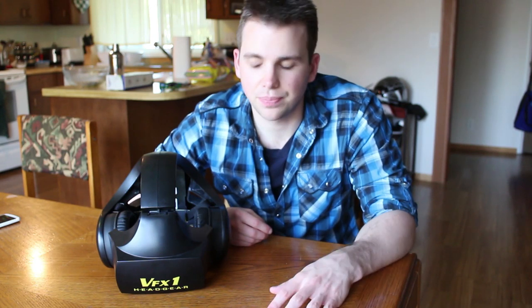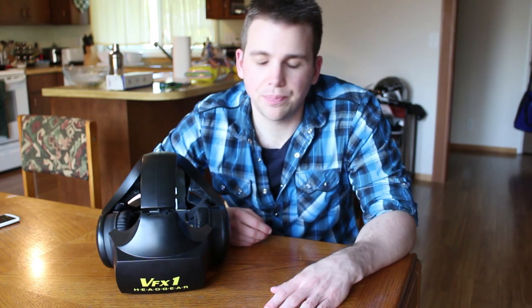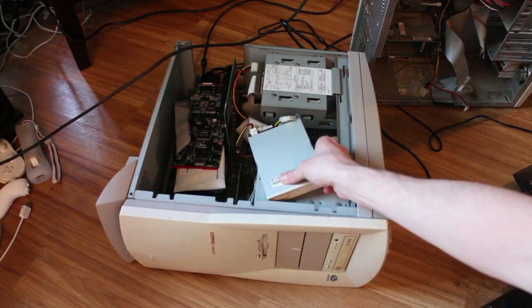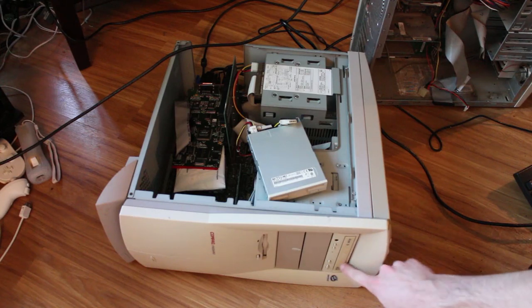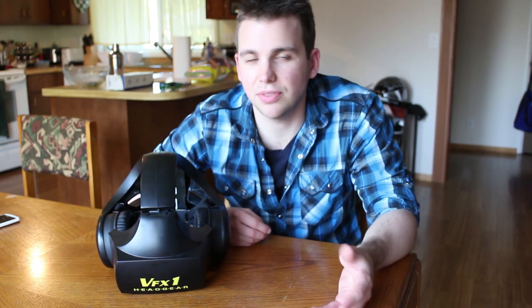Once we had the right computer, we had to get the operating system installed. That meant installing either MS-DOS or Windows 3.1, or maybe Windows 95. We opted for MS-DOS 6.22 because it was easier to get and easier to install. Although it actually wasn't that easy for us to get it installed. We had a computer that could only boot to floppy disk or hard drive. We hoped that it would boot to the CD-ROM, but it didn't seem to work. And on top of that, we couldn't get into the computer BIOS because the thing was so old, it required a boot floppy in order to alter the BIOS configuration.